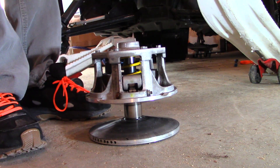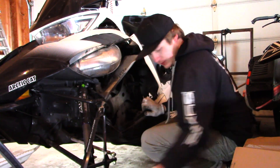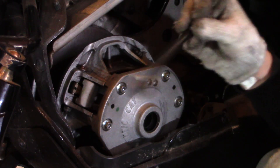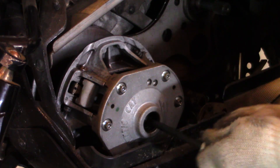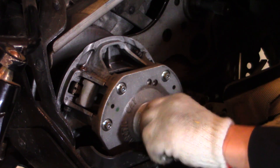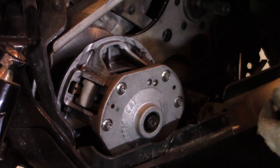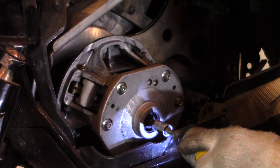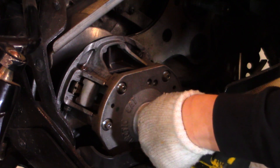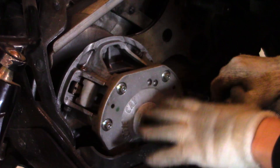All right, so old clutch here — piece of junk — we're going to keep the parts. And beautiful new clutch. I have our bolt — make sure we have the washer on the end of it. I'm going to start it by hand with my fingers. Definitely don't want to go right to impact on this. I'm actually just going to use a small impact driver just to save a little bit of time. Go until she's snugged up. Beautiful right there. And now we're going to torque this thing up.